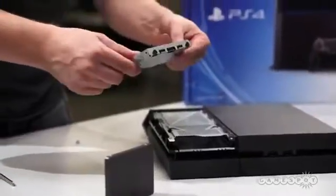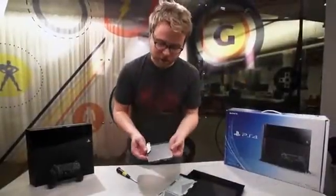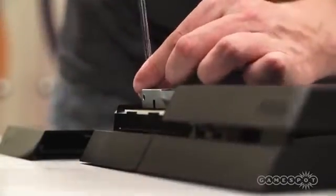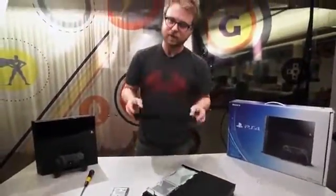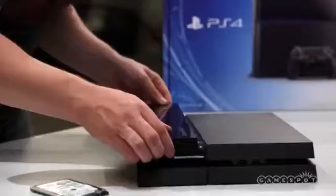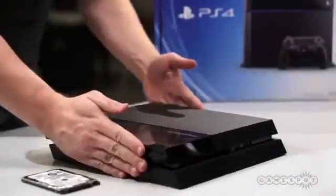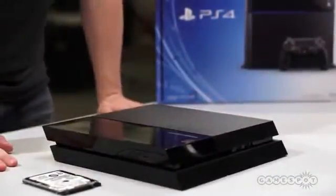There are a few more Phillips head screws — we're going to undo those and show you where we're at once those are taken out. We've got the new hard drive screwed in there. We're going to slide it back in and replace that one screw that we took out earlier. The panel is a little bit hard to put back on. Rather than coming from the edge, position it past the little plastic fins in front and slide it back in. That's the PS4 with a new hard drive installed.